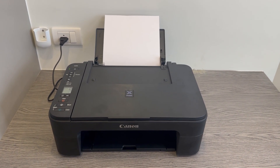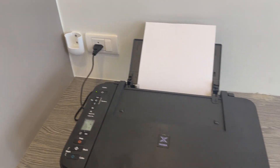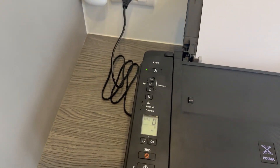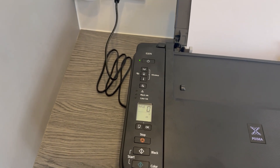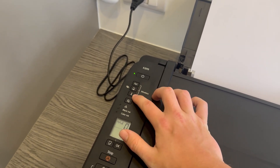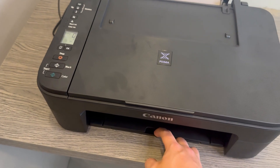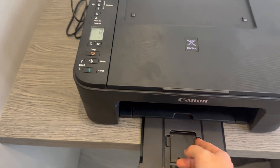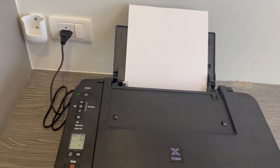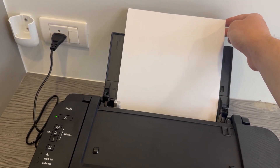What you need to do is go over to the left-hand side of the printer. First of all, make sure that it's plugged in and powered on, and that you have it connected. You're going to need to locate the 'I' — the information button. Before anything, make sure that the paper output tray is out to catch your paper, and that you have at least two pieces of paper in the machine, because you will print two information sheets.